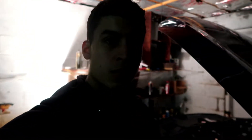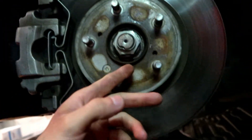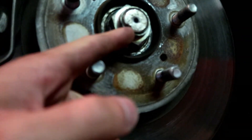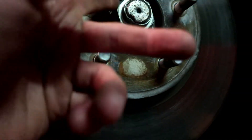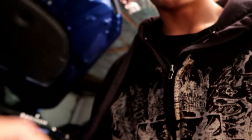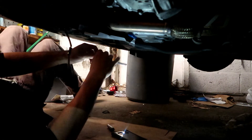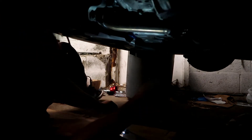Let's change the plans — we're gonna take the downpipe and front pipe off first because of lack of time. I can see there's a bent piece right here, not a crack but it's bent in. I need to find something to bend that off so I can spin the bolt off. So we're gonna take the downpipe off first, then the front pipe. Lighting is gonna kind of suck but this is what it is working in the garage with no lighting.